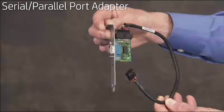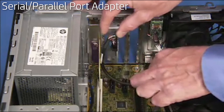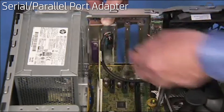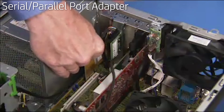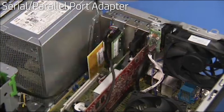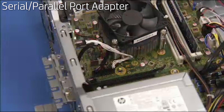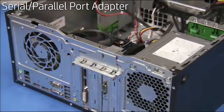To replace a serial or parallel port adapter, align the back slot edge of the adapter into its position at the rear of the unit. If installing a parallel port adapter, the adapter will hook into part of the PCI x1 slot on the motherboard. Reattach the connector to the motherboard. Rotate the expansion card's retaining bracket into place to secure the adapter.